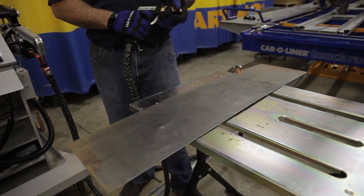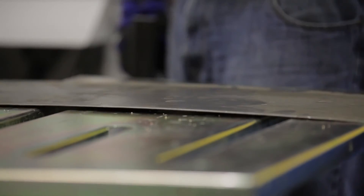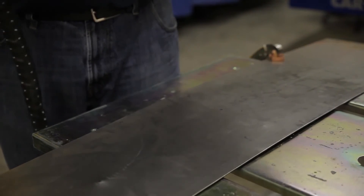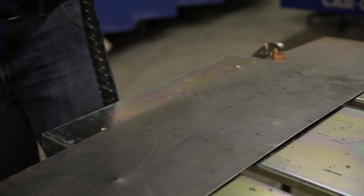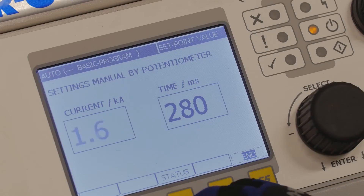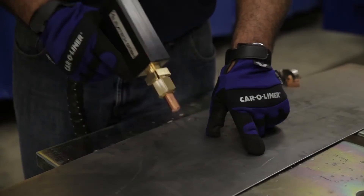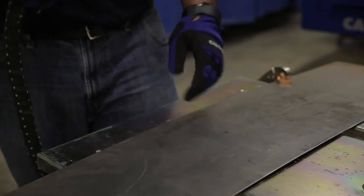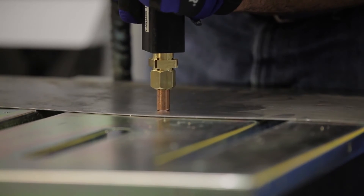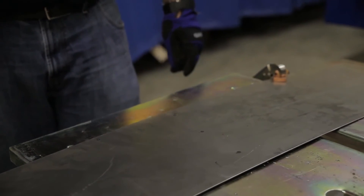For this application, we're going to work with what's called a contact shrinker. We have here where we've made a high spot trying to pull a dent out, and rather than trying to pound that down with a hammer or heating it and shrinking it, I can take this blunt-ended copper adapter. I'm going to change my heat settings a little bit, maybe bump up the time. We're going to put a good amount of pressure against this and use it to heat shrink that dent. We're able to actually drop that down from a high spot to a low spot.